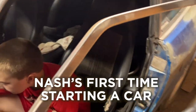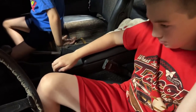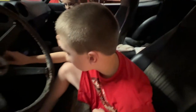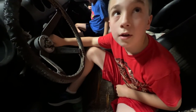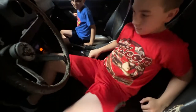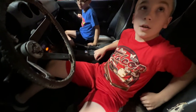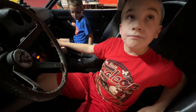Alright, why don't you try starting the car. First of all, pull the choke back. When it starts, get ready to push it forward, because it'll be like, rawr. Okay, turn the key to on, all the way to the on position. You'll hear the fuel pump. There it is. Now give the gas pedal a couple of pumps. Yeah, one more. Is it in neutral? Yes. Then hit the start button.